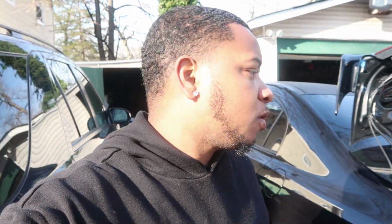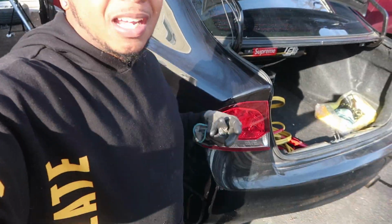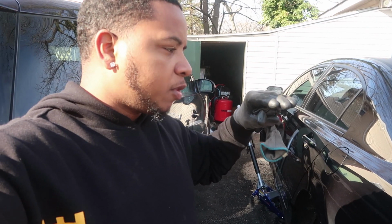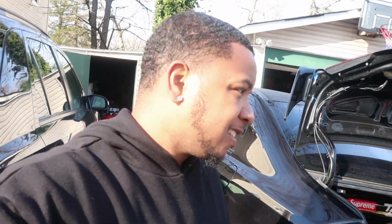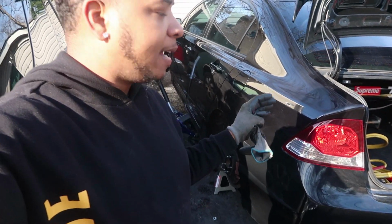What's up, everyone? So, I'm outside now. You guys got to see my Christmas gifts. But I wanna adjust the rear. I adjusted the fronts because this side, for some reason, when you air out, it doesn't go past the tire. It's like midway, and I don't like it. So I think when I put the bag on, I didn't push it in all the way, so it kind of has like positive camber. So I took it off, pushed it forward to see if that would help.